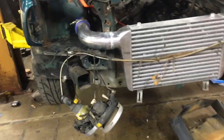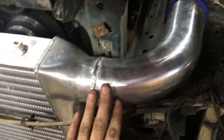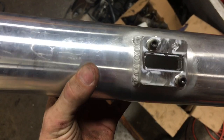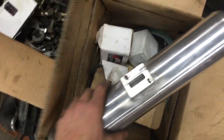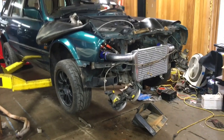Quick update — I brought the intercooler and the MAF flange over to a buddy and had the charge pipes welded on. I may need to change the angle or setup a little bit, but they at least fit now, which is fantastic. It may be mounted up top, not sure yet. The Hitachi MAF flange does indeed fit the Miller MAF, so as long as the tune still works, this should work perfectly. Remember, 18 inches of pipe is the minimum uninterrupted length needed for proper calibration. That's all for today — I'll be cranking on this during evenings this week as well, so stay tuned.